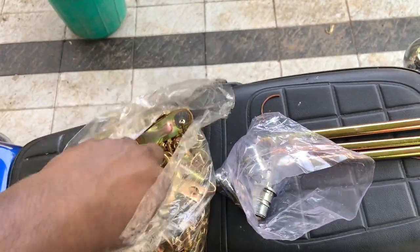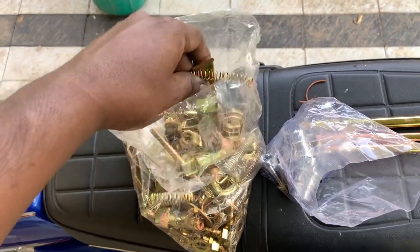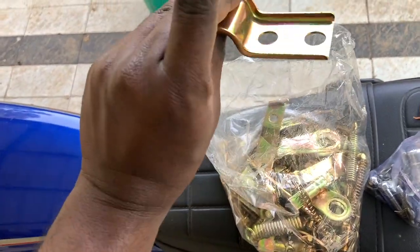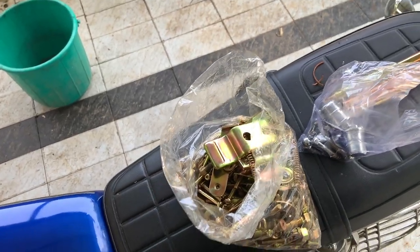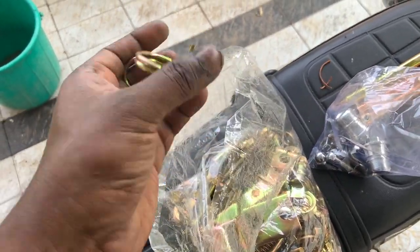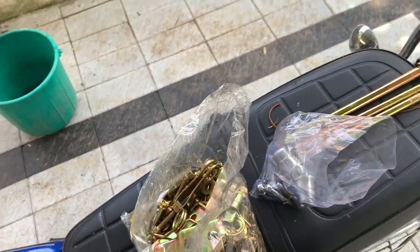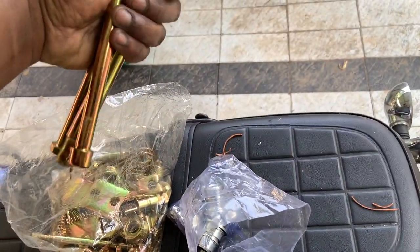There are a lot of small small parts — springs, stand springs — all these things when zinc-dipped actually cost a lot less. You can see these are the headlight visor bracket and this is the seat bracket. It is a great thing to zinc-dip everything because it gives you cheaper, OE-quality parts with a new finish. Look at this spring — it looks as if it came out of the factory. Trust me, this is a 1997 model bike and these things came in the bike in 1997, so almost everything you see here is OE. That is actually an awesome thing.